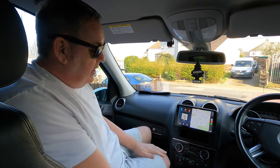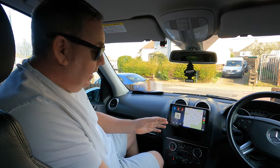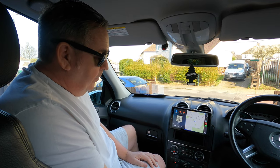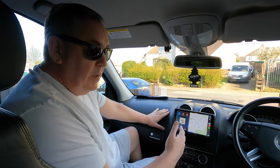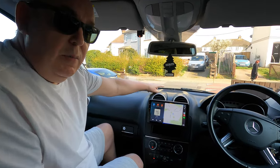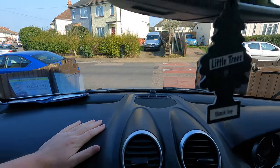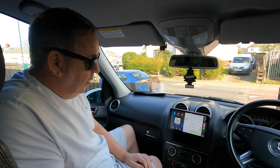Getting back to the stereo - as you can see I've achieved the floating panel look I was going for. We've got Apple CarPlay on there, your songs, your maps - Waze, Google Maps, Apple Maps - everything works perfectly. I did have a little trouble in the beginning because they sent me a dodgy GPS aerial and the car thought it was in a different location. We've mounted a new GPS aerial right up at the top of the dash, nice and square in the middle of the window, and now it all works absolutely perfectly and seamlessly.